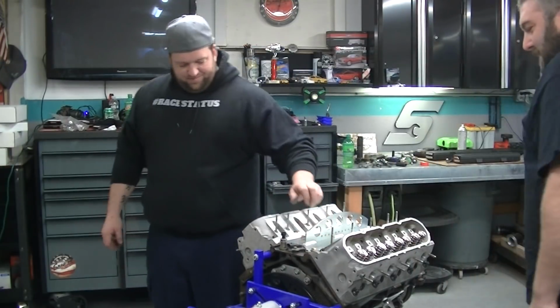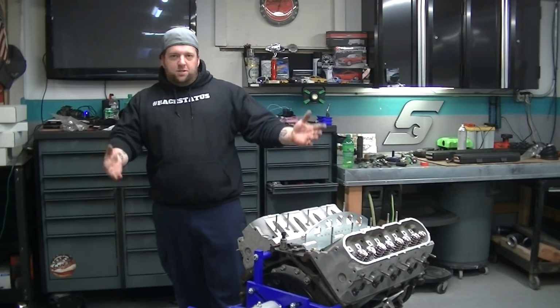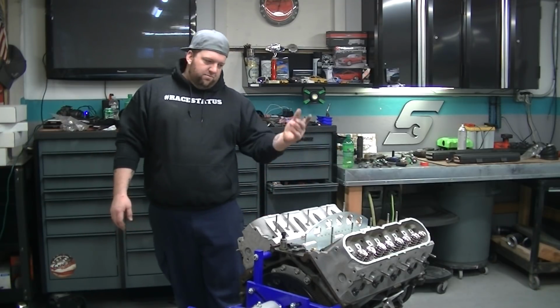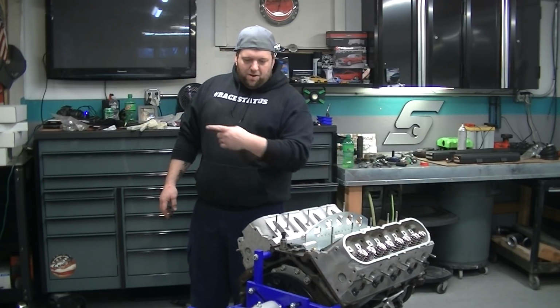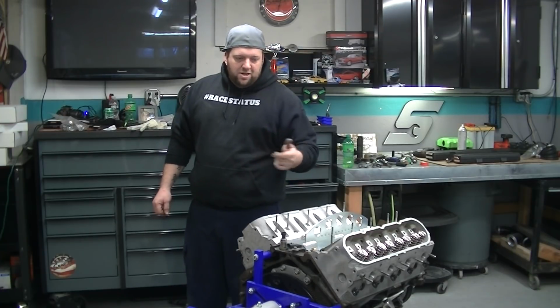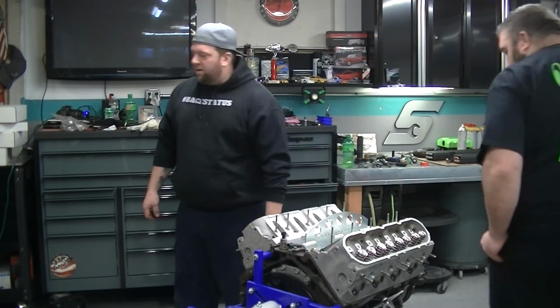That looks like the best mechanic ever. Alright, so the heads are bolted on. That's done. That was easy, like usual. It's a pushrod V8. Now we gotta put the push rods in, put the rocker stands in, torque down the rockers, and hopefully the push rods are still the same length. I didn't have them cut much, I just had them clean it up for a gasket surface because they were straight as an arrow.